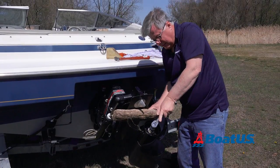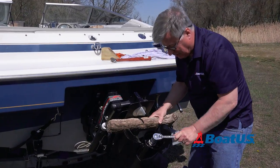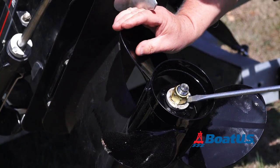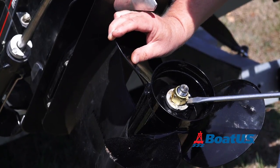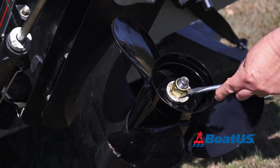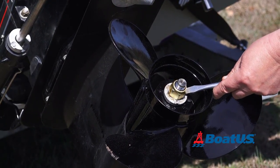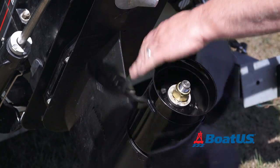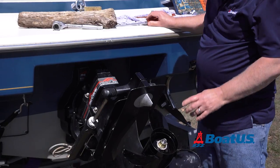It just needs to be snug, so we'll do it nice and snug. You'll see that I've tightened it until the flat is level with the tag, and just bend those up either side — I can tap that with a hammer a little bit. Check it again, make sure it's free to rotate, and we're all good to go. We should be getting nice full power but using less fuel now.